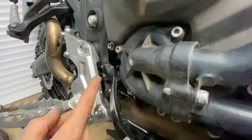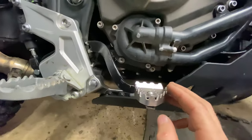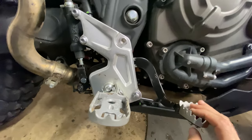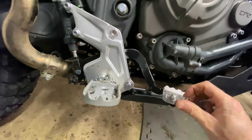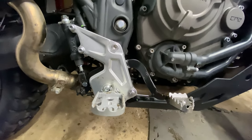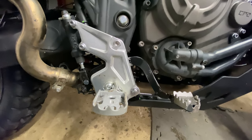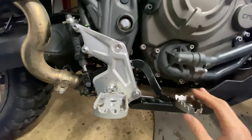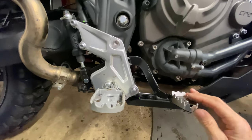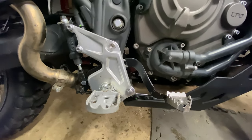This part disconnects from the piston and you can pull it all the way through the frame. It will fit if you loosen those other bolts, then you can bend it to your heart's content and fit it back in place. Obviously if you're unsure, take it to your local dealer. I do a fair amount of my own maintenance but I'm no expert — if you're not sure about your brakes, go to your dealer to be double safe. Hopefully that helps.